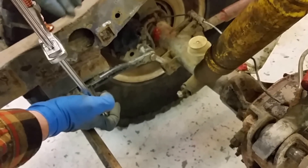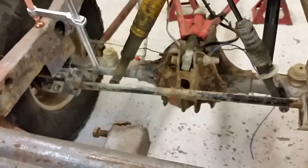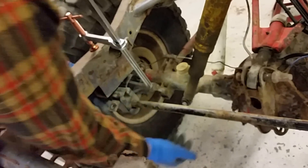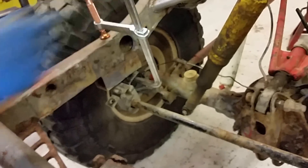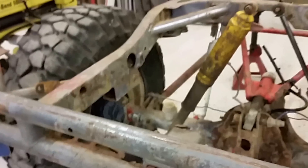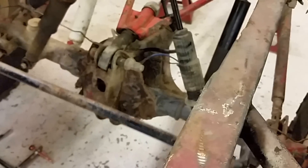We'll put it on that side. As you can see, anywhere it goes — now we're going to go up. It's coming out. Exactly like that. See, this is stretched out here — straight. We got a straight line — that ain't going to go anywhere. That's going to have a lot of force on it. So what I'm saying is that that was limiting our wheel travel, and that would make the big thump at the top — that's where it was at. See, it's straight there now. You've got to have something with longer arms. There's another three inches right there, which is critical if you're airborne — you need it to droop all the way down. If it can't droop all the way down, we're losing travel to absorb the bumps.